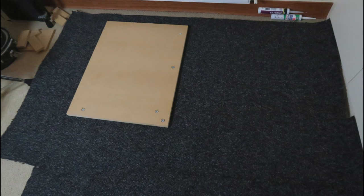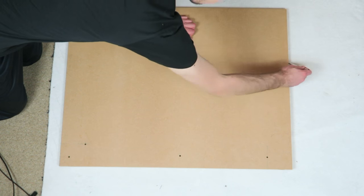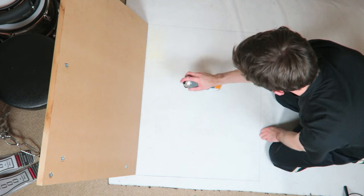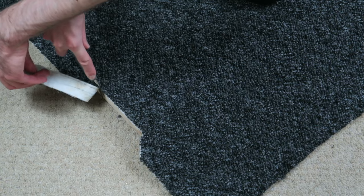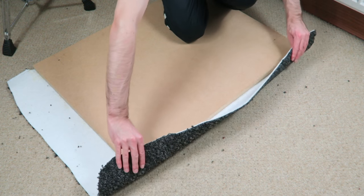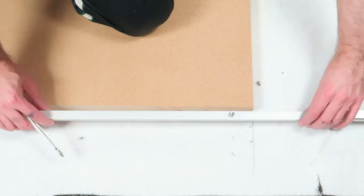The carpet was a rest piece from a carpet shop and cost only 10 euro — a thick dark grey carpet with an additional insulation layer. I divided it into four equal pieces and marked the area to be covered with spray adhesive. Always open the window when using spray adhesive inside. I let it dry for a bit, then cut away the sides that will face the other parts of the platform with a sharp knife. It is important to cut away the correct parts, otherwise there won't be material to cover the edges. The edges can be covered with a 6 cm overhang that is marked and cut accurately.